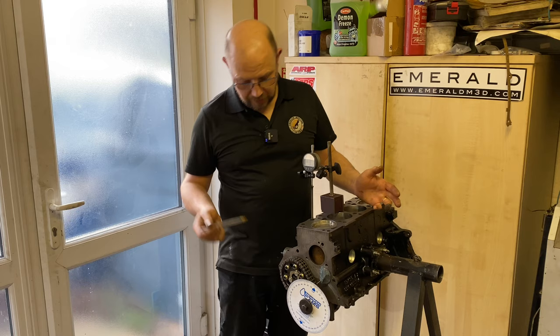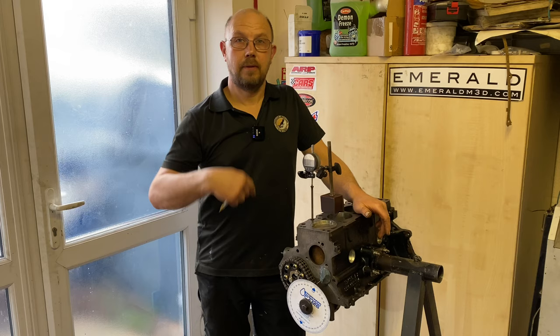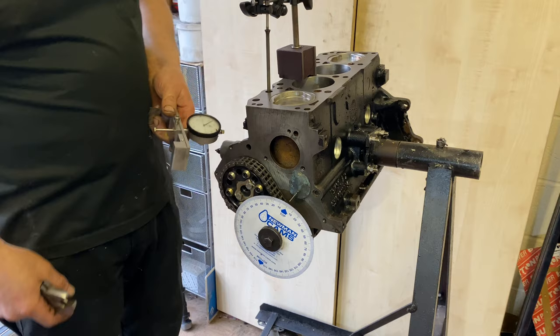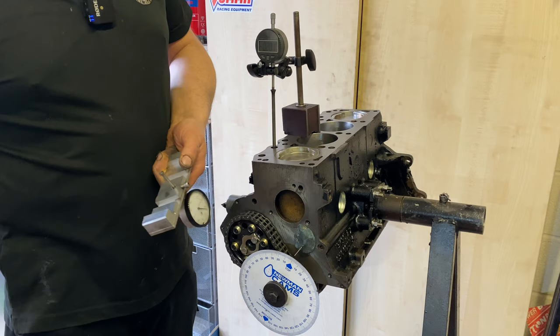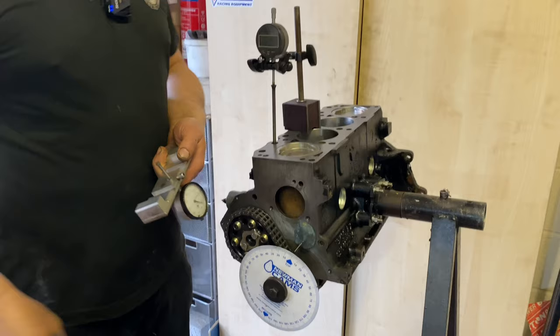In this instance we've got an adjustable vernier, which means we can adjust the position of the cam in tiny increments in relation to the crank. To do this we need a couple of tools: a dial indicator gauge — that one's digital, this one's mechanical analog. We need a way of measuring the cam position, a protractor so we can measure degrees, and a pointer — sometimes it's a bit of wire I bolt on, sometimes it's a bit of plastic with a small drill bit in the end.